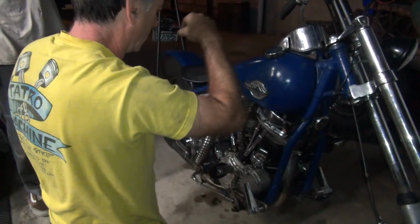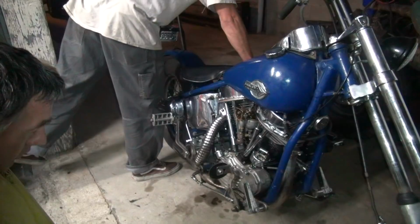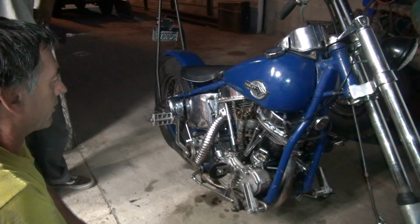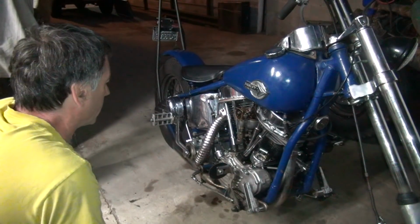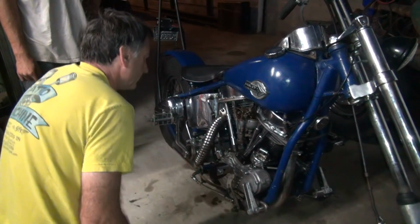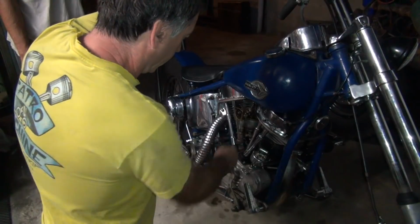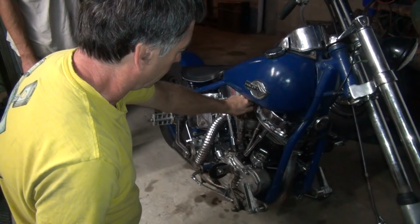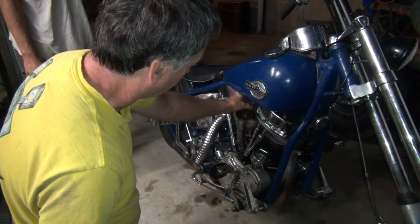Wow. Okay, so we have major issues. It's not getting any fuel at all in the idle circuit. So turning that jet on and off isn't doing nothing for it. Well, we put that plug in there. That's not the idle circuit, that's the main circuit. Oh. The choke right now is only 3/4 away and it takes half to 3/4 to run on. So, for some reason the needle is not, you just keep unscrewing this damn thing, it's almost all the way out.